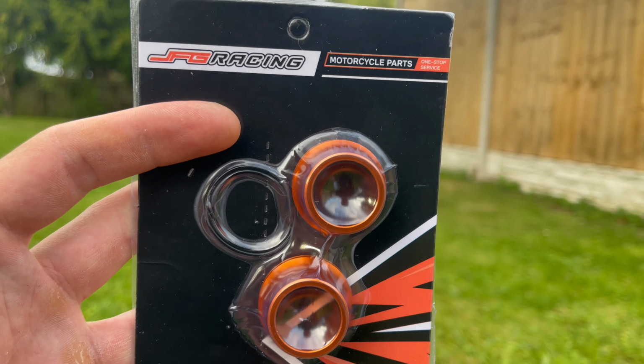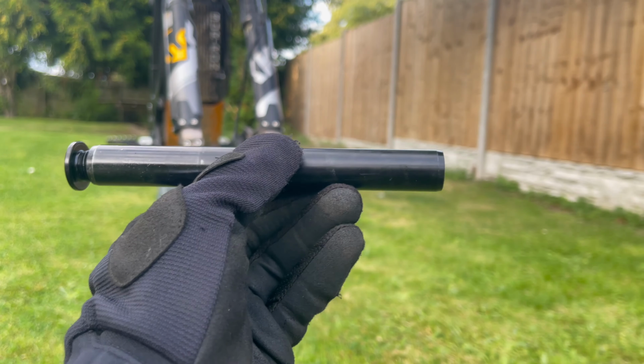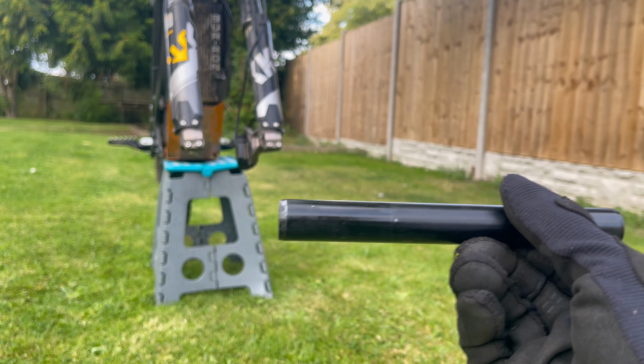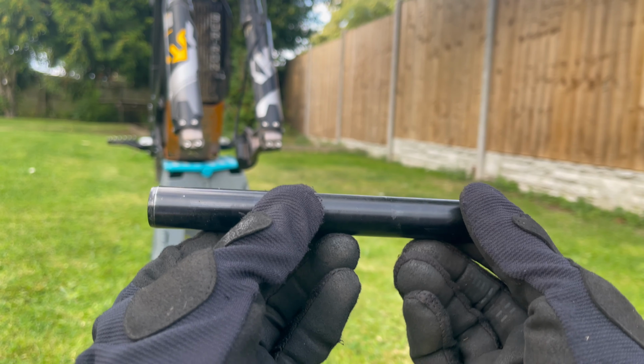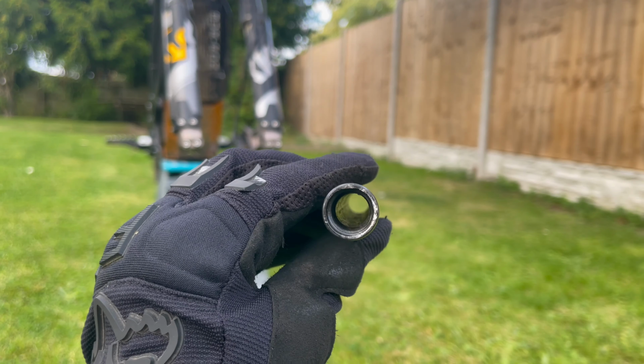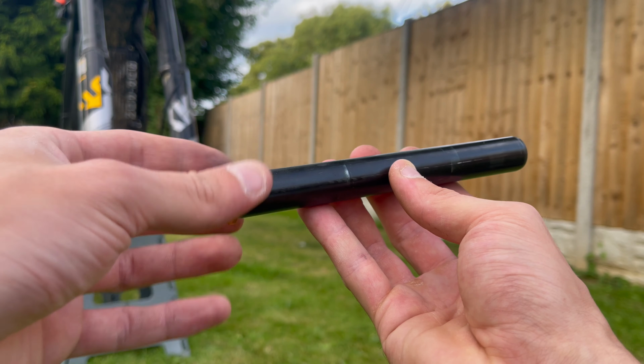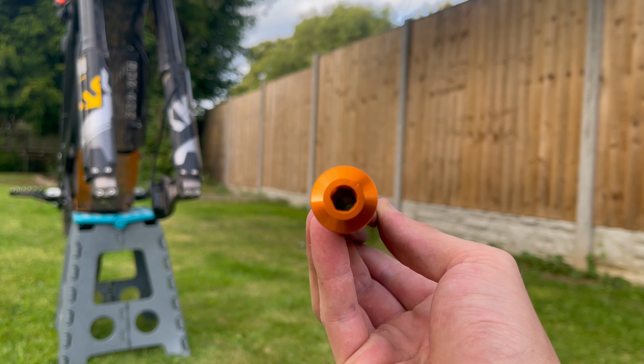And on the front axle, like I mentioned, there's two nuts, one either side. One's already removed because that's how we got the axle out of the front of the bike. The other one can then be loosened and taken out of the axle, so you are literally left with just the axle itself, no nuts in either side, ready to be replaced. So then, like mentioned, I changed the o-rings over from the old spacers onto the new spacers, so they had the seals in ready to go. Then I got one of the new orange nuts that I was putting back on the bike, and I put this tightly in the axle, ready to be put back on the bike.